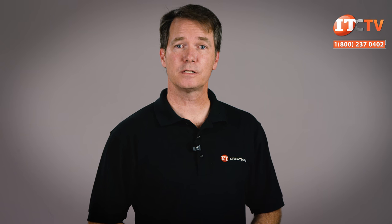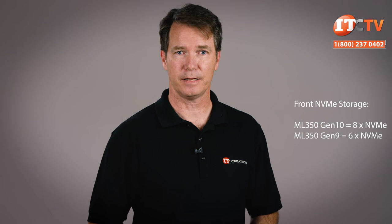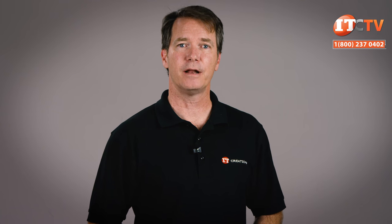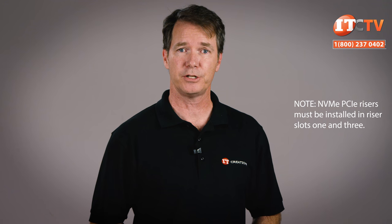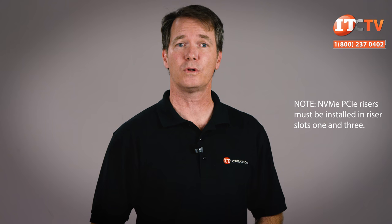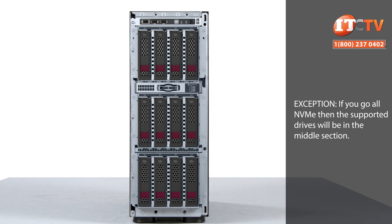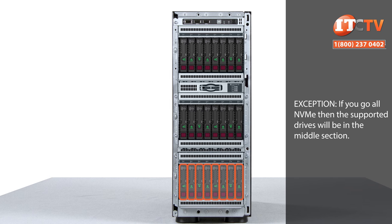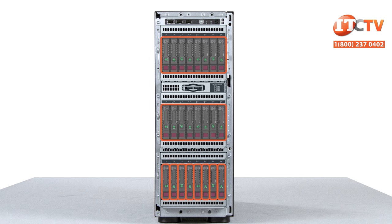You can also install up to 8 NVMe solid-state drives using an NVMe SSD express bay enablement kit, which provides two more NVMe drives than the Gen9 version. The NVMe cage can only be installed in bay 2, which is the middle drive bay on the SFF drive configuration. NVMe drives will also require one PCIe riser per four NVMe drives, for a total of two risers for eight drives. Each configuration supports a default drive cage at the bottom of the chassis with either four 3.5-inch drives or eight 2.5-inch drives.